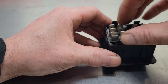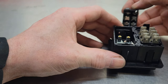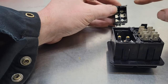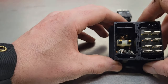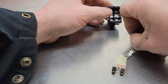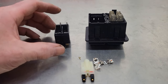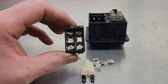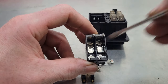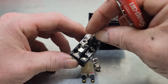Release that, then lift it straight up. Some of the pieces have already fallen out. Stop right there — instead of just dumping it out, take a look. We've got a spring here, so it's a pretty safe bet that it goes right back in that spot. Now take a close look at all the parts that came out. We've got where the connector goes on, and we've got some contacts on the top and bottom.